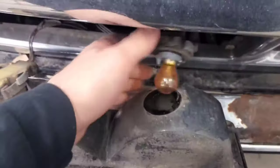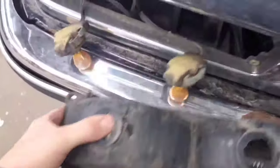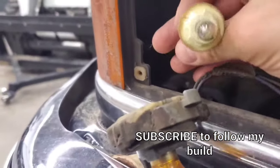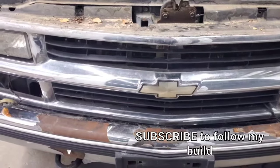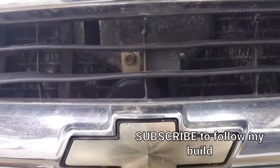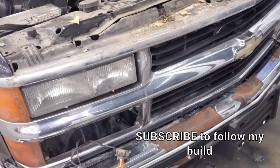Push this tab in right here and twist — comes out that easy. There's your light, super simple. Get your hand in behind here and just twist it out — that's how you take your lights out. So you pretty much got everything out. There's one secret screw right above the emblem, seven millimeter head. Now we have all the hardware out.